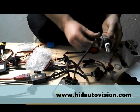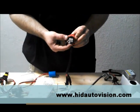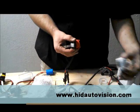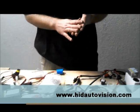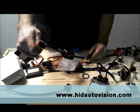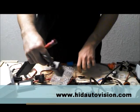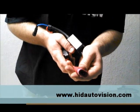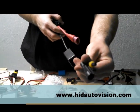That's pretty much it for our D1S. D4 bulbs and D3 bulbs are the same — D4 is the same as a D2, so all the same setup as we showed you for this one. And a D3 is the same as a D1, so same setup there as well. For the most part, all your connections are going to be the same every time. You're always going to have this as your input from your factory harness and you're usually always going to need the adapter. The only ones you don't need adapters on are 9005, 9006, and H10. All bulbs have the bullet connectors, so you'll always use those.